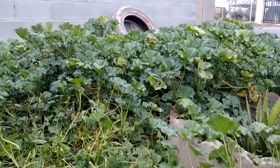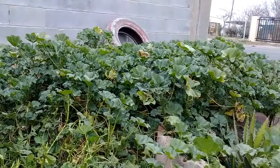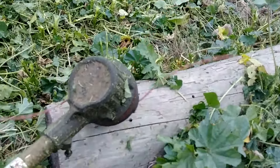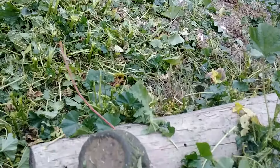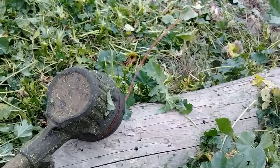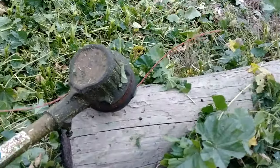There you have it. That little winding noise is a little protection that the weed eater has — it's protective against overheating or burning up the motor, kind of like a brake. The reason it does it is because since I have the guard off, you can tell the line gets pretty long. The guard is supposed to cut the line so it doesn't get too long and overload the motor. I took that off, but it still has a safety that prevents your motor from being damaged.